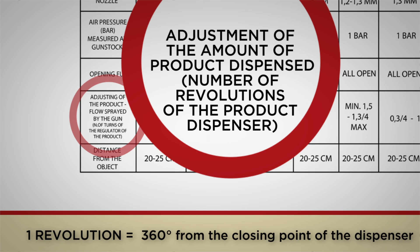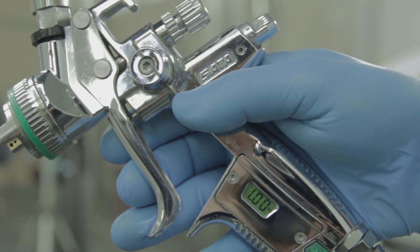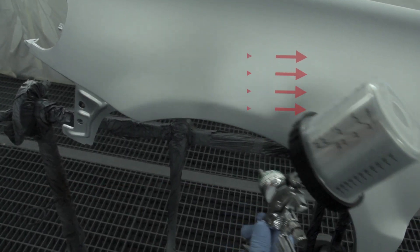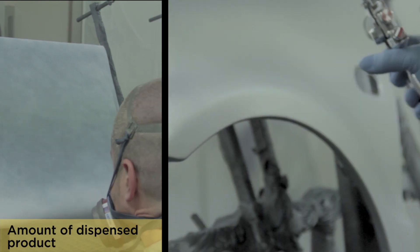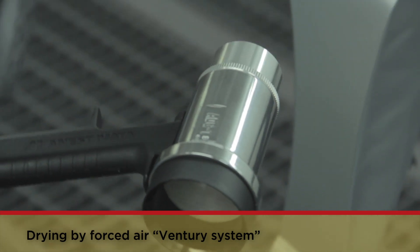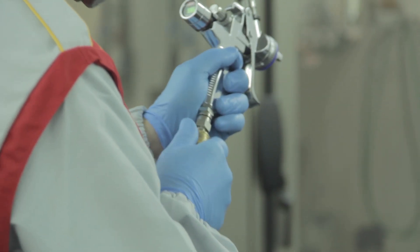Using a SATAJET 4000 HVLP gun, the operator is setting air pressure to one bar and the amount of product dispensed requires setting of the airbrush at one revolution. The final fading out on the still wet diluted binder is executed degrading from the touch-up center towards the external area, keeping a 20-25 cm application distance from the support. Through the application on a white sheet, the amount of product needed for a proper final fading out is demonstrated. The application of a higher quantity of product compromises the desired tone of shade, not allowing aluminium to position itself on the surface as necessary to obtain the required result. When the product is well dried, product fume can be applied if necessary; otherwise, proceed directly with the application of the clear coat.